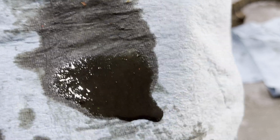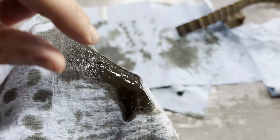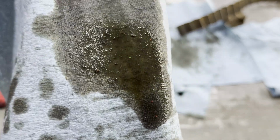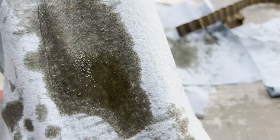So now this is the oil that I've scraped, and you can see there's a tiny bit of material. You can see this red thing that looks like some silicone or something from assembly. There's no major chunks. There's a little green thing that looks like something from assembly, maybe a paint pen. Overall there is a little bit of debris, but it's nothing concerning. We're looking for brass pieces, large pieces of bearing material, but everything I can see here is nothing out of the ordinary, nothing to be concerned of.